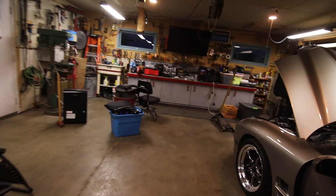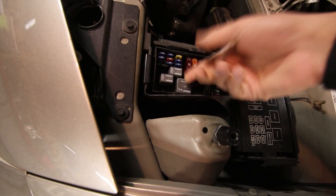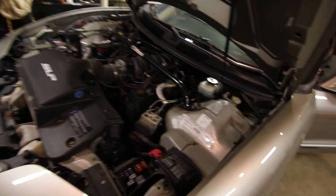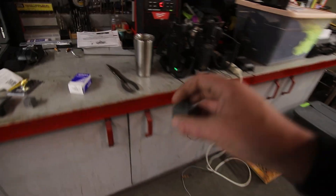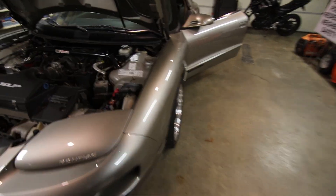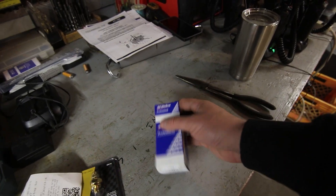All I can really account for is that I did monkey with this relay, so I'm going to swap it out just to be safe and keep a spare in the glove box — cheap insurance while you're out motoring around. Until it acts up again I don't have anything to go off of since it's working. I'll put the ignition relay back and put the new AC Delco relay in. Hopefully this gremlin has gone away, but it'll more than likely rear its head again.